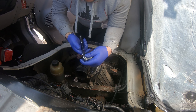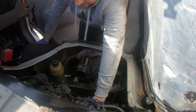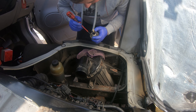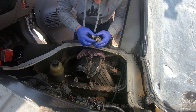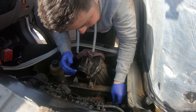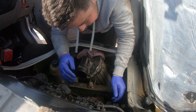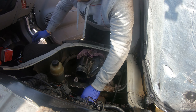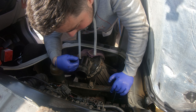To get the engine bay open on the Bongo, there's a little screw there just under the ashtray. That just lifts out and then you peel back the carpet here — there's a clip on there, and then you've also got a clip there and a clip there. Then just stash these screws and it should just lift. There she is — little peach.